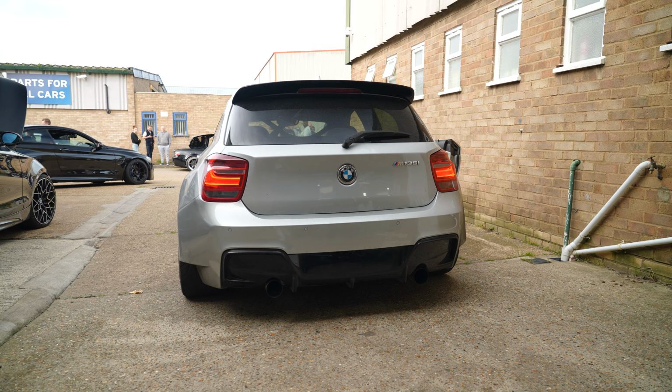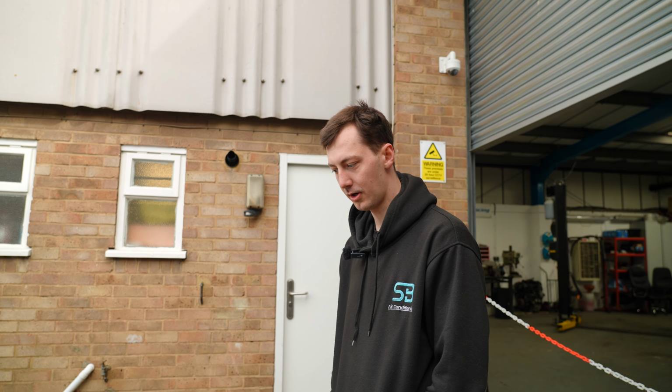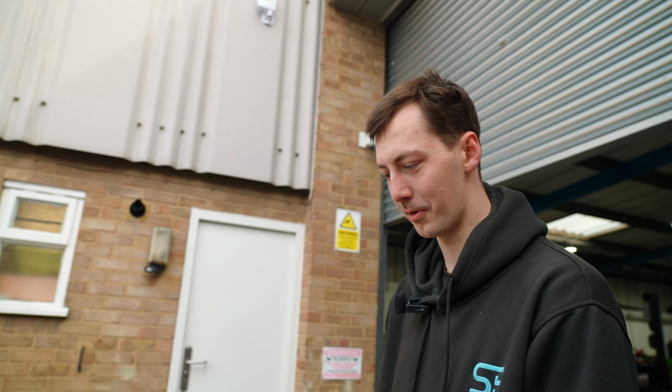Jesus. So Charlie, that sound that we just heard, just want to talk us through it. How come it sounds like that? Is it decatted, straight pipe, the whole system? Oh, I don't think I can say that on camera. All right, so what system do you normally run anyway? So normally it's a high flow sports cat, resonator delete with a Helmholtz chamber, so it's an anti-drone pipe. And then a modified back box that I did myself, but because Tim, obviously, we need something savage, he's a bit of a whinger, so I changed the exhaust to something that looks a bit nicer rather than a stock back box. Fair enough.